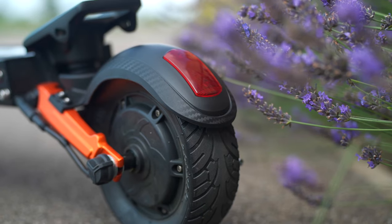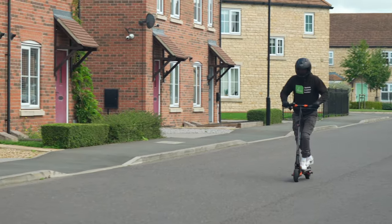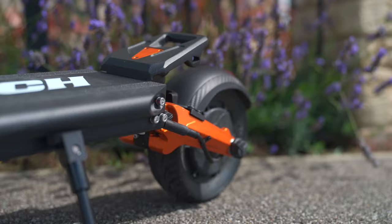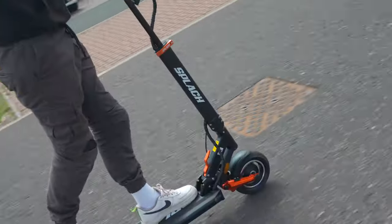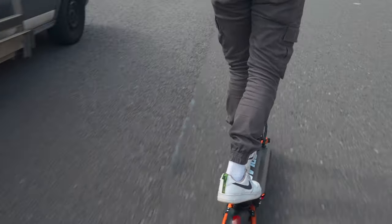With the Ranger's focus on range, its power in the speed department is limited. Equipped with a 36-volt, 350-watt motor, it has a top speed of 22 miles per hour. While I managed to reach the claimed top speed, it took an extremely long run to hit it. The size of the motor isn't sufficient for propelling a 45-pound scooter plus the weight of its rider. By comparison, scooters with the same size motors tend to weigh around 31 pounds, making the Ranger 45% heavier than similarly powered models.